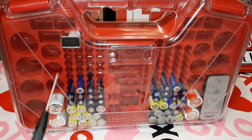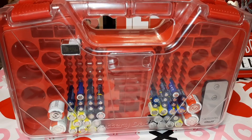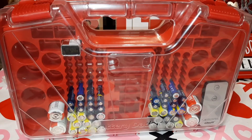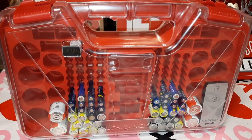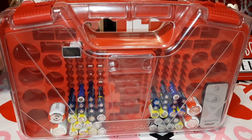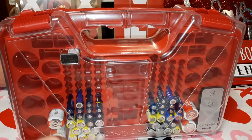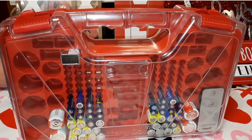Also, the tester has a screw to hold the cover in place, so they should include a little screwdriver in every kit. And last but not least, they should add dielectric grease. You just take a little bit and put it on the ends of a battery or electrical fitting and it keeps moisture from gathering and causing rust. You can get a little pouch of dielectric grease at NAPA for a dollar sixty-nine.